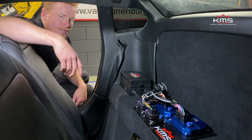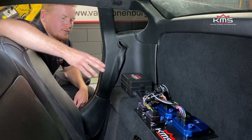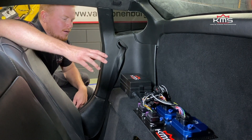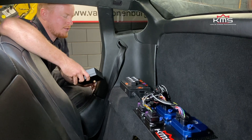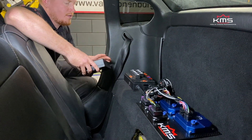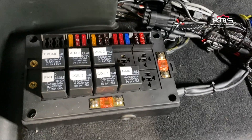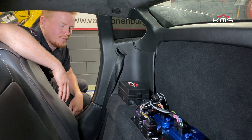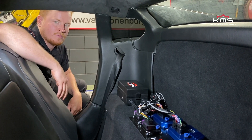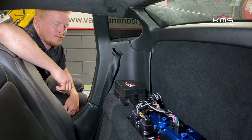The original Lamborghini engine is also controlled by two ECUs, one for each bank, so we did the same. We also made all the fuses and relays in a nice little box for the customer. It still looks a bit messy, but the car is far from finished as you can see from the outside and inside — the customer is going to finish it himself. We only made it work technically, and the car is running now.